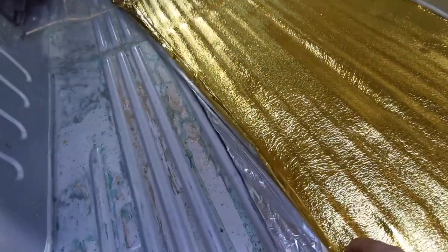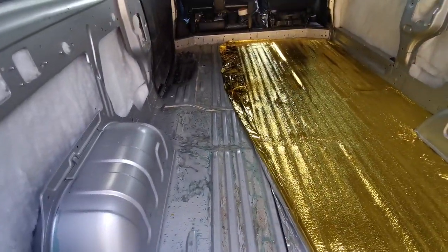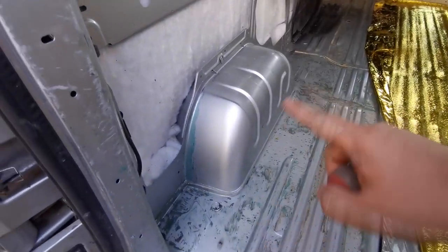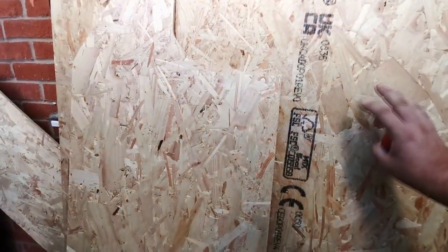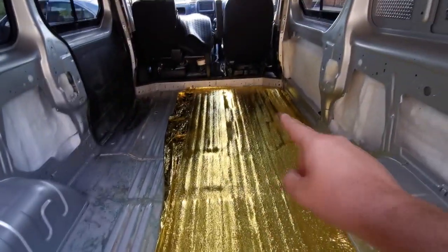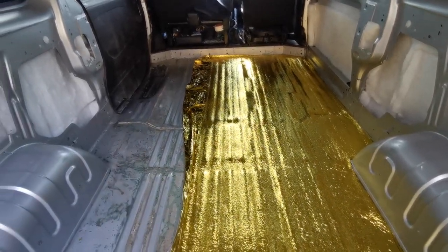What I can do now is fold this bit of foil back across all the way along, run the second piece in, and I'll see if I've got enough to do these wheel arches and get them done as well in today's video. Once we've got this foil on the floor, we'll get the OSB floorboard in that I've cut ready, and hopefully we'll get a few screws in and that'll be the floor all secure. I've got them black lines up there - they're just in line with the ribs and we'll go ahead and screw them down.